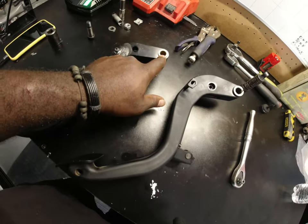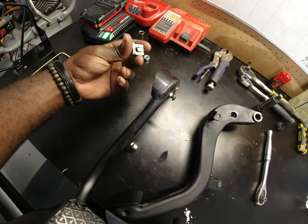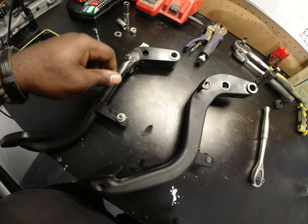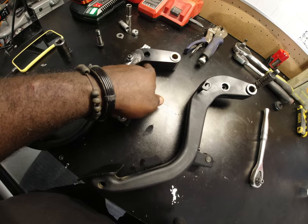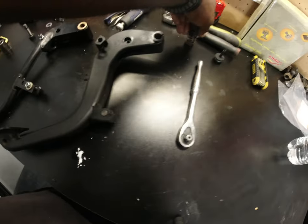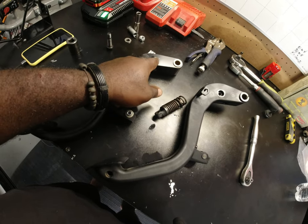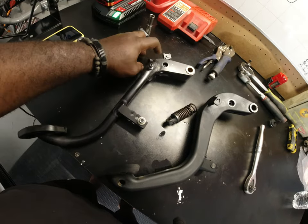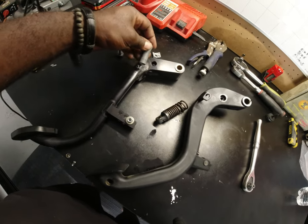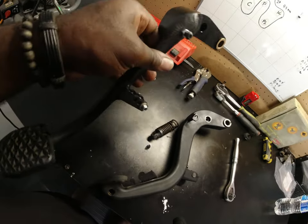The way I want to install it: first, slide it into the pin and slide across, then use the lock pin to keep it in place. Next, put the spring in first to make sure that's in place, then get the slave cylinder in and tighten everything up. Put the light-duty spring on and connect it back, and that should be it — after that we'll test it out.